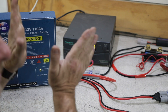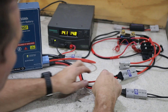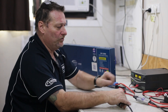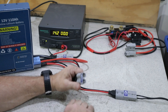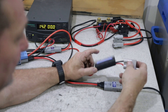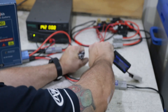Your grey Anderson plug is where you connect all your loads and also your solar controller. I've put one of our parallel cables on here because I'm using power through the smart shunt to supply power back for the smart shunt so I can see it on the phone. You could also use that for whatever you wanted — you could put your solar controller into this for instance. This is a little monitor that you can plug in to show you how many amps are coming in, the actual battery voltage and so forth.